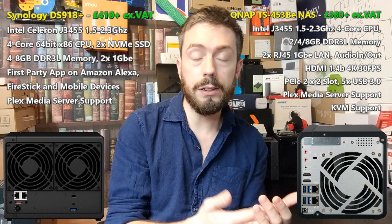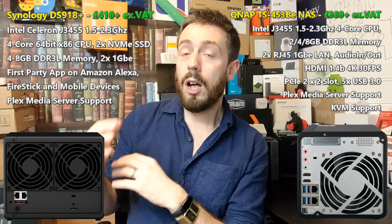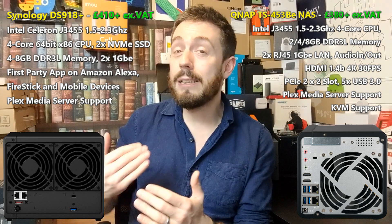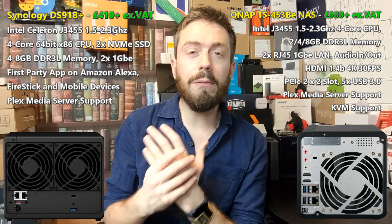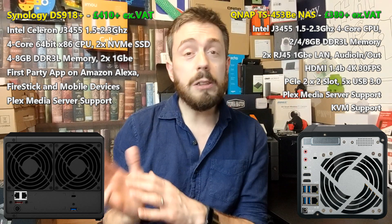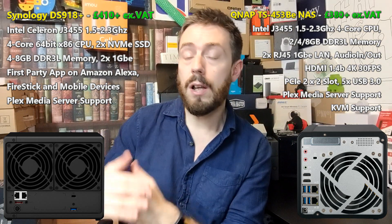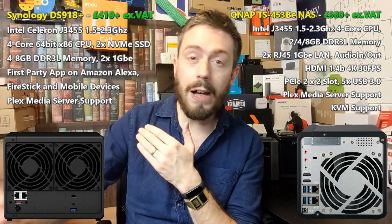Those cards will cost you extra, ranging from as little as £50 all the way up to £200 for the more fully-fledged multi-port cards. The Synology doesn't have a PCIe upgrade slot, but it does have NVMe SSD cache bays, meaning along with the four bays of storage you can add SSDs for hugely improving read and write speeds. There are two schools of thought on this: one school says that's brilliant — you've got NVMe SSD cache bays by default and the prices between the two devices are so similar, that inclusion is great, plus internal operation speeds are vastly improved by SSD caching. However, you are going to be limited externally to two Gigabit Ethernet, so the performance benefits from SSD caching will always be restricted by your external network connection.